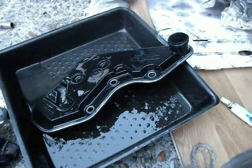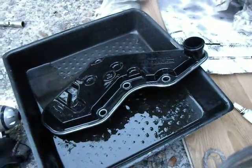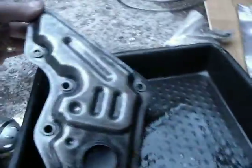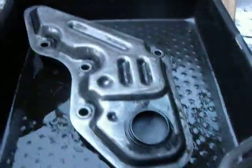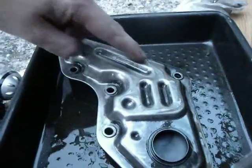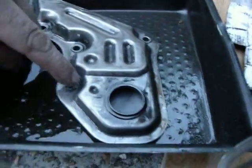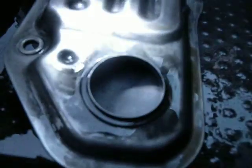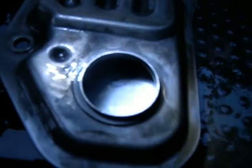Last thing to do tonight is to flush this out with a bit of petrol because the filter area is absolutely huge. It's a mesh that extends all the way around the inside of this. Looking at it, if you can see, looks pretty clean to me.